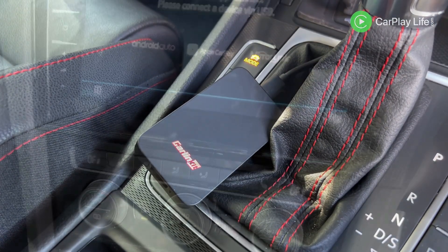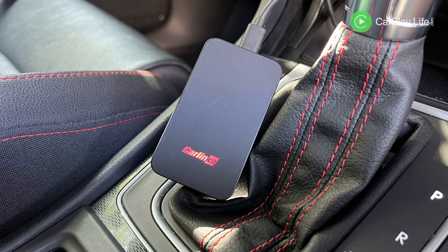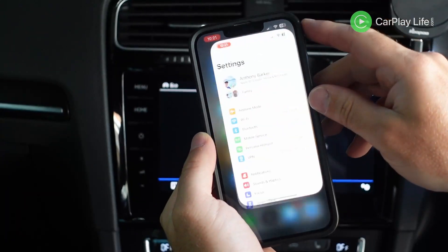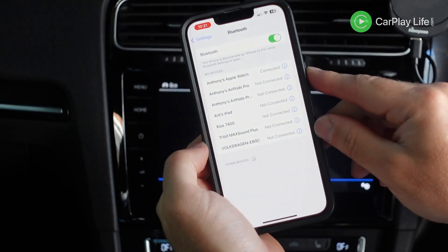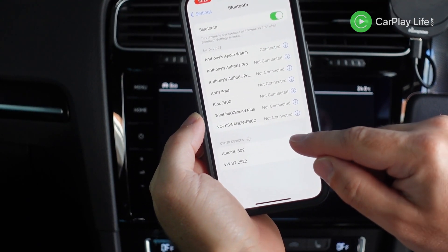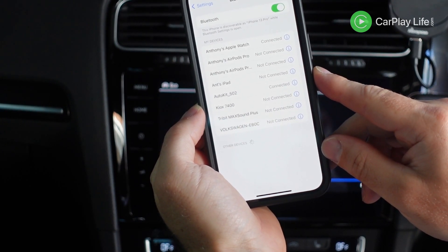Also, check the manual to make sure whether the adapter comes with or without a home screen. Some adapters, like this CarLinkit 5.0 wireless adapter, simply don't have a home launch screen when you first connect. So it's easy to think the adapter may be broken — but it isn't. By looking at the adapter you'll see it is powered up on the display indicator. So simply pick up your iPhone, go into its Bluetooth settings screen, and you should see the adapter's Bluetooth ID appear. If you don't, turn off Bluetooth and turn it back on again and wait a few seconds.